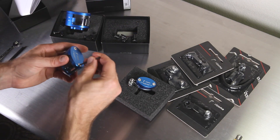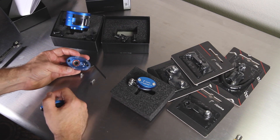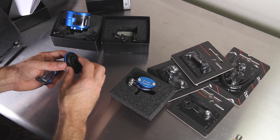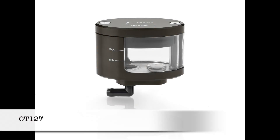The CT-125 is virtually identical to the CT-127 in construction — again, a sturdy o-ring at the bottom and a diaphragm up top. One thing to note is that some OEMs use DOT fluids and others use mineral oil, so make sure that you check your owner's manual to see which fluid you need for your application.